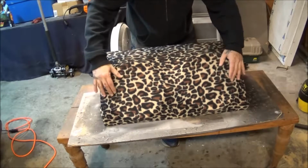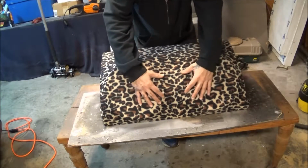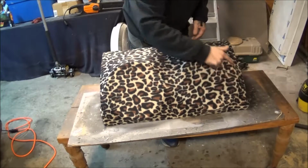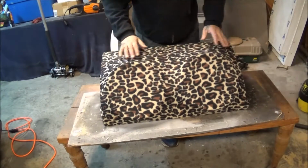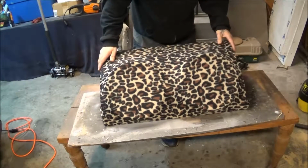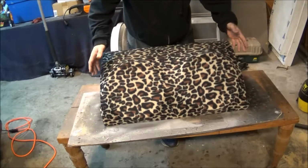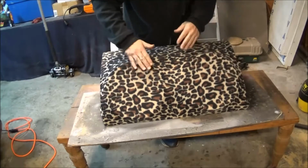Whenever you set your speakers down in there, whenever it's finished, you'll want some separation. So this gives you the separation. It helps define where the rings are, so that when this is all finished and fleeced and fiberglassed, it'll look better for one, and for two, you'll have a much better surface to mount your subs on.